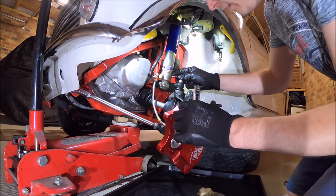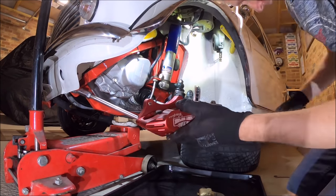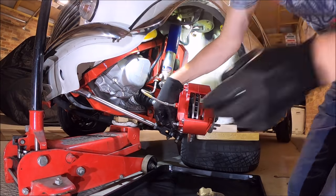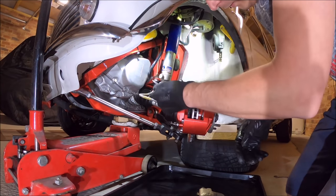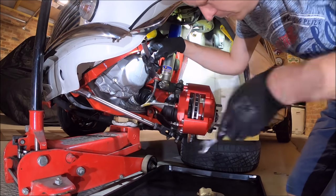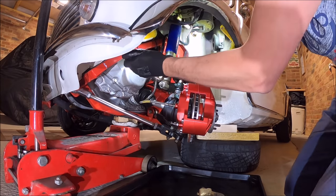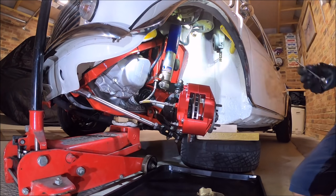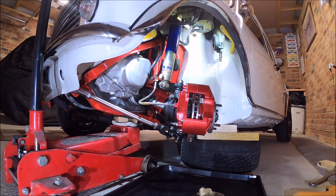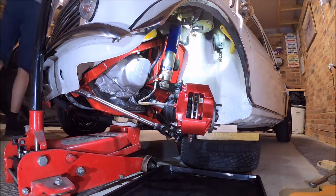Important here to make sure the brake hose is not twisted. It's much harder to notice on a braided hose because they're a bit stiffer, but it's very easy to do on a rubber hose. Even just half a twist in the hose can affect the flow of brake fluid and you can get a brake imbalance — it'll also fail an MOT test. To do it properly you need to slacken off the bolt, slacken off the pipe, and then twist the hose accordingly so that when you tighten it up in the caliper it's not twisted. For MOT, if it's got more than half a twist in its length it's a failure.